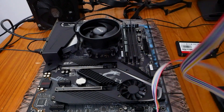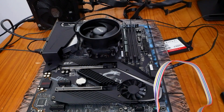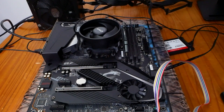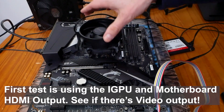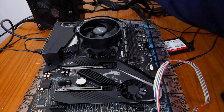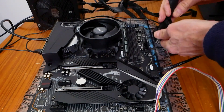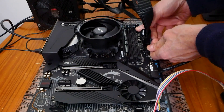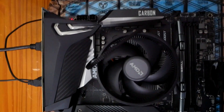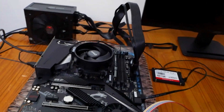I've got standard out-of-the-case connectors and hooked up an OS with a standard SSD. I'm going to plug it in and use the Cooler Master V550 to see if the output from this CPU works. If something's wrong, I'll put in a PCI Express video card and check from there. If not, we'll try to flash the BIOS. I'm hooking up the CPU power — maybe we can get it to run. Fingers crossed.